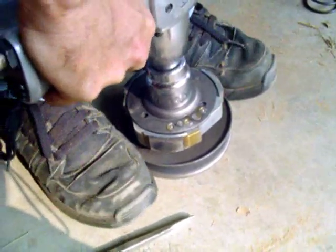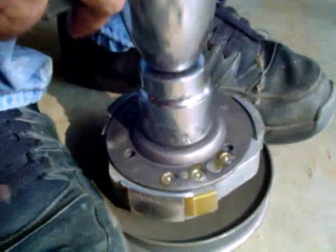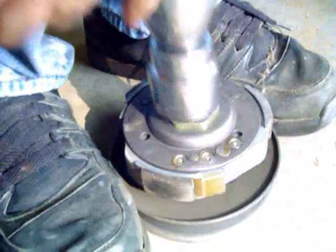Nice and easy. We've still got a little bit more to go. That's good right there — we'll give it one little boost for good measure. That's where it was before. You can see the marks are lined up exactly where they were before. If you have a proper torque wrench and a way to hold it, you can certainly torque it to manufacturer specs — but this is the way we're doing this one.